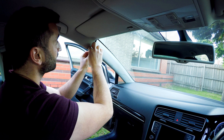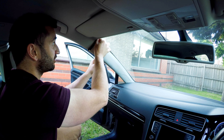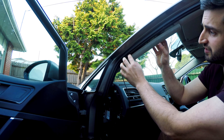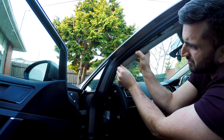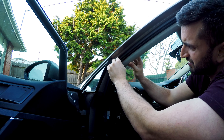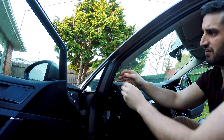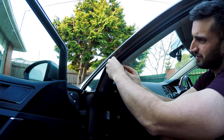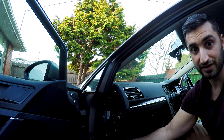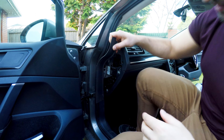You don't need to go overboard. Slide one end through there and push it up. Now that we know the length of the cable, run the cable all along the side here and put it through down the bottom. Then we're going to push the side pillar casing back on — make sure you hear it clip back in place. From here we're going to run the wire through this seal here; you just feed it in by hand, quite simply, and then it'll stay in there. Pull from underneath so it's nice and tight in there.